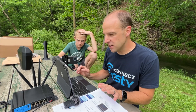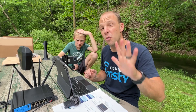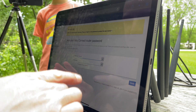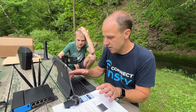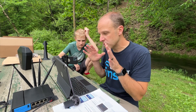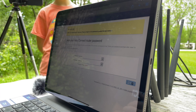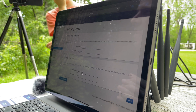Once we get to my Insti, we click to run the setup wizard and we start with an InstiConnect router password. You're going to want to remember the password that you put in here. You're going to have to enter it two times and make sure that it matches. I suggest a stronger password for this because whoever has the password for this router will be able to change any settings inside the router. Once you click save, it's going to save your password and move on to the Wi-Fi setup wizard.